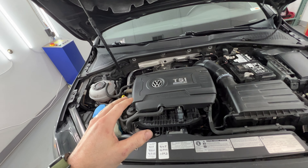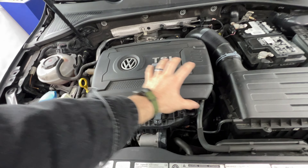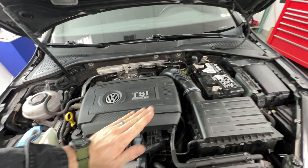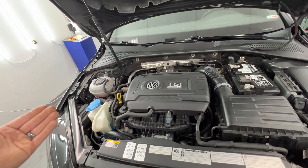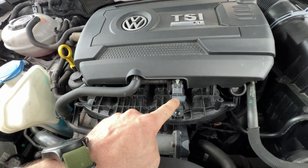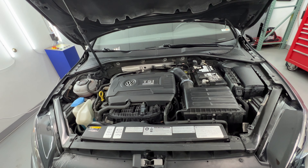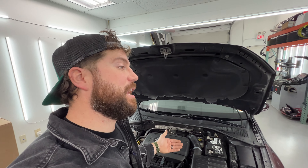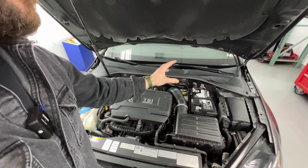For those of you who don't know what a BoostTap is, it's simply a device that gives you a port somewhere on your intake tract that runs a tube to an analog boost sensor so you can take a standalone boost reading. On most modern cars you don't actually need one because you have a map sensor on your intake manifold or somewhere on your charge pipe that's going to take an accurate boost reading for you. But if you're running a piggyback tuner or a different map sensor scaled vastly different than stock, you can't always accurately read that using an aftermarket gauge system and you will need a BoostTap.